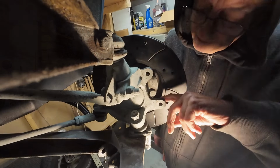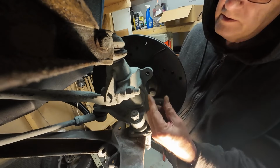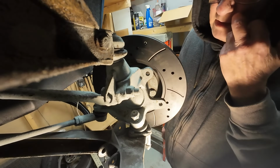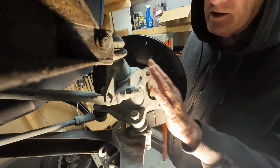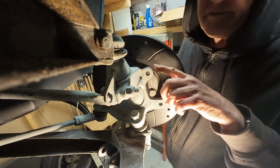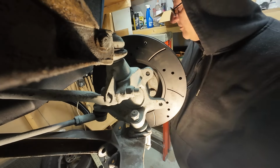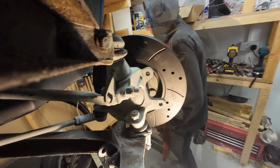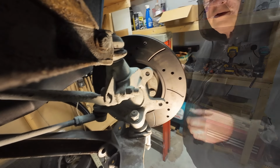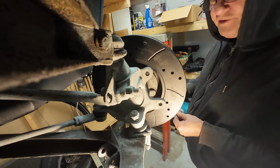Okay. So the bolts will come in from the back, a bit finicky, and bolt this block of steel that's going up here, because these are bigger discs, so the caliper can't go right back, and even if it could, it wouldn't matter, because the centres of this are 90mm and the centres of my other caliper are, I believe, 130, but we'll check. I reckon that the centres on these Brembo calipers are about 113mm.